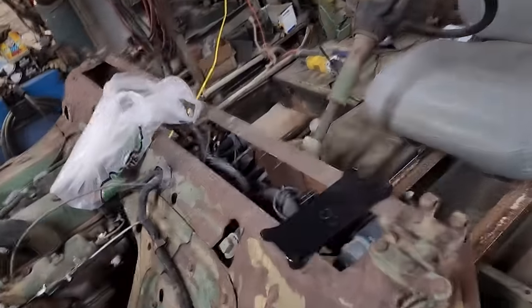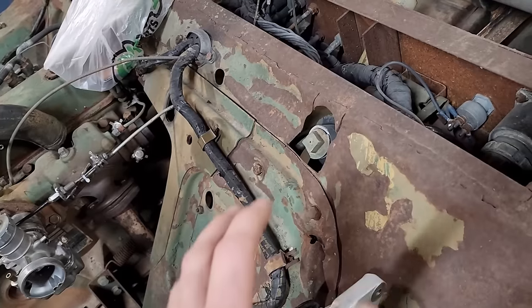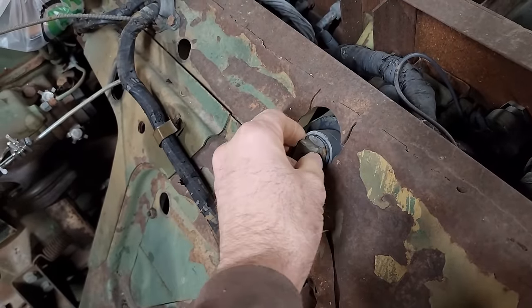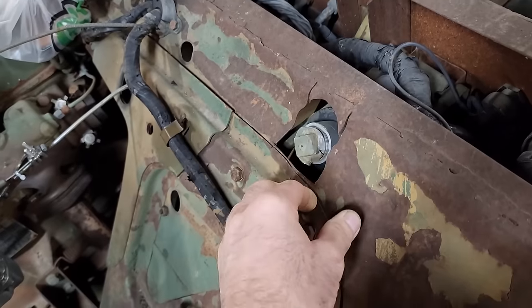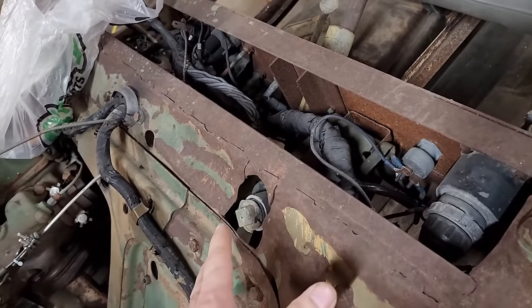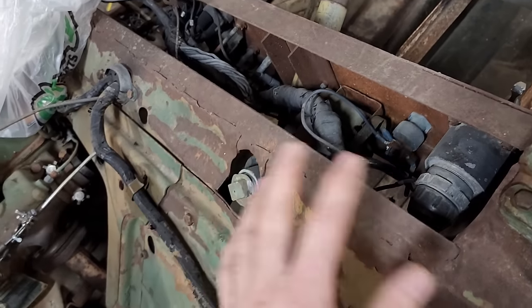And I know I've never even mentioned or showed that I've looked at the brakes, but right here is the master cylinder, and obviously it doesn't have any brakes. The one time I did go to check this, yeah, it's all busted and broken. And as we've already established, this thing's been sitting outside for years. I don't know how many years, but this is kind of like the transmission, I'm guessing. Whereas the water was getting into the transmission, draining right on through it, I'm guessing there's a massive leak in the system somewhere. Because if there's no brake fluid in it, and it's been sitting out in the open, rainwater has surely been finding its way in there, but it's finding its way back out again.